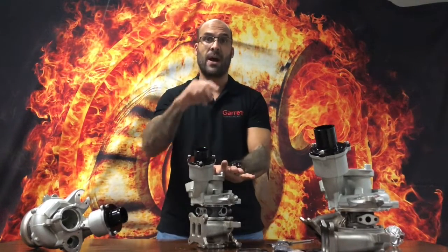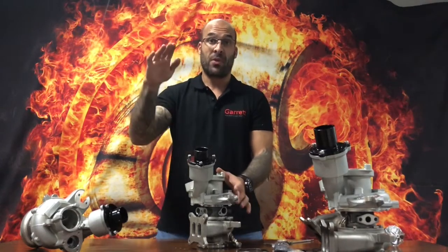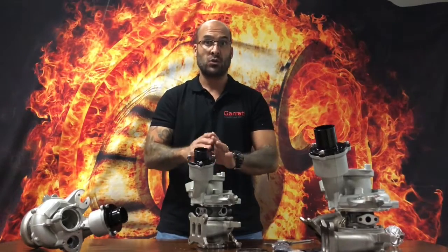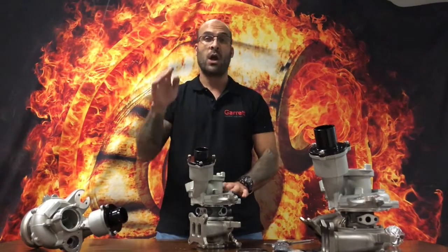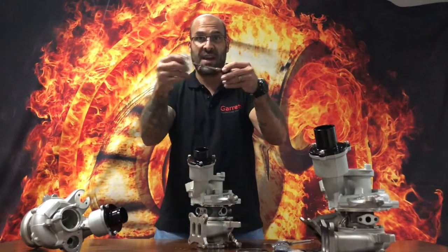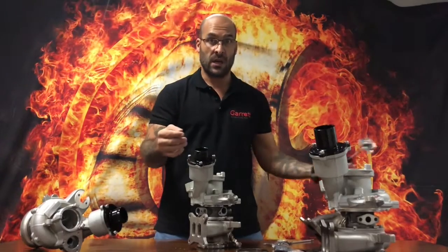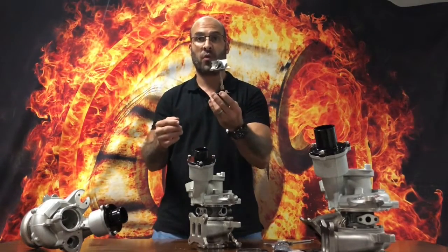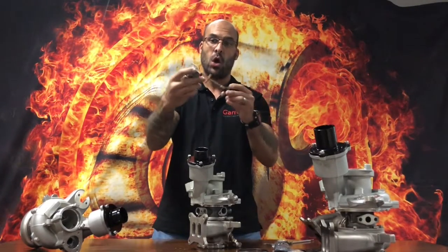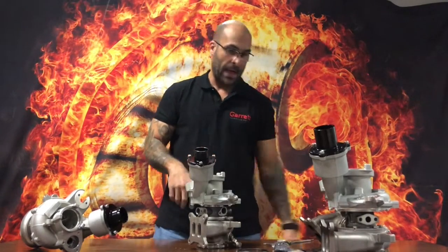Today we're talking about a more affordable option with less horsepower. You'll make a reliable 580 to 600 horsepower at 2 to 2.2 bar boost all day long without suffering the previous thrust assembly failures. Check our YouTube channel for links to previous videos where we actually explained what the cause of these thrust failures are on the IS38 hybrid builds.